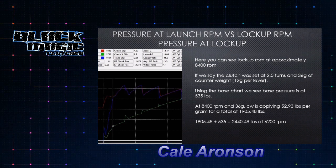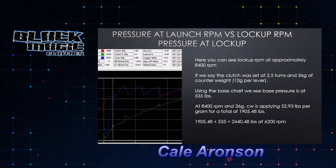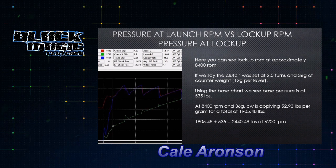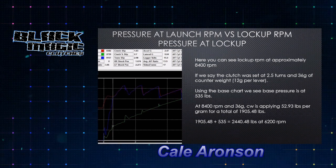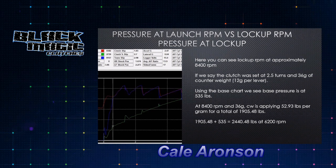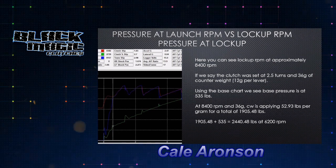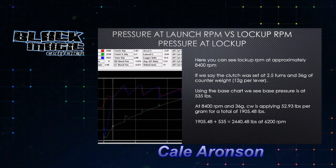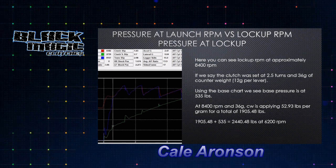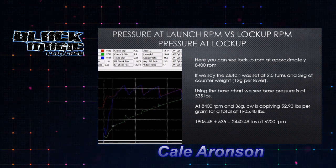What I want you to pay attention to on this particular graph is how the engine RPM goes up, lays over, and comes back in. The reason for that is a gear ratio thing, and not being able to continue the movement of the tire. The thing most people underestimate, or don't quite wrap their heads around, is that part of what you do with a clutch is you're really trying to control wheel speed. At the local bracket tracks, you'll see a car with a big, big tire on it. They stick the tire, and it does no revolutions upon launch other than staying completely hooked up. That's where you're losing a lot in clutch tuning. Our job is really to control the clutch slippage more than anything else.